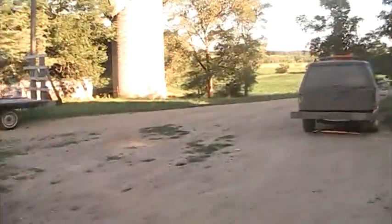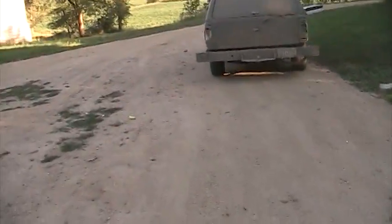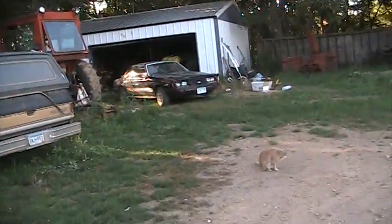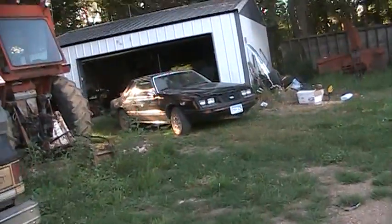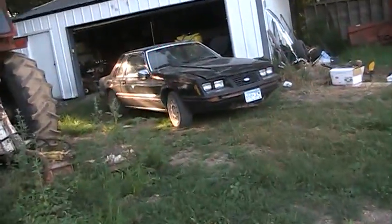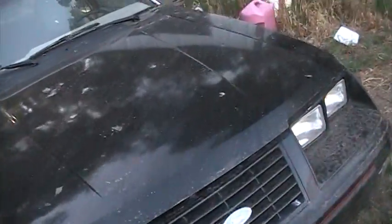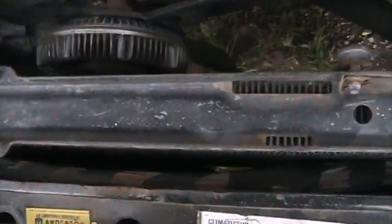So yeah, this ain't really much of a video, just kind of a quick update on vehicles and such. Otherwise the Mustang's fine. I mean, it definitely needs an oil change, plugs and wires. I think it only has a 4-cylinder radiator. I think it needs to be updated to the 5.0 radiator. Actually, let me just check and see if anybody can tell me offhand. I don't know if the 5.0 radiators have an extra core in them, because this is only like a 2-core radiator, I do believe. And I think it can be up to a 3-core.